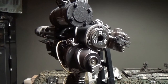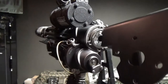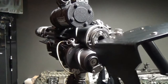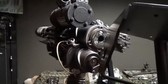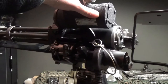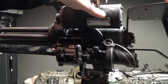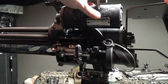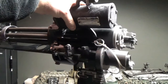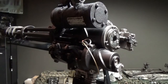One of the reasons we need a spacer when running our clutch is because most of the grips readily available on the market today — these are Crane Technology grips, which is what most people use — are just flat here. Because they're flat, the clutch cannot sit up against them. The clutch is going to be spinning in the back, causing friction and hitting the grips. Also, you can see this piece coming off the clutch is about one inch.